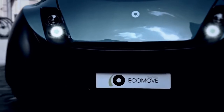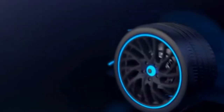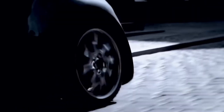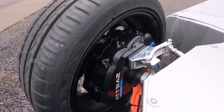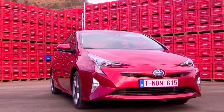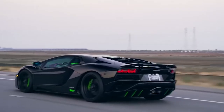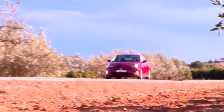The electric motor is the component which drives the car. The in-wheel active suspension system is an electrically operated system that can respond in as little as 3 one-thousandths of a second to automatically correct pitching and rolling actions. Some in-wheel motor layouts also deliver regenerative braking — the system captures some of its kinetic energy while braking and carries it back to charge the battery. Many hybrids, such as the Toyota Prius and Tesla Roadster, have already combined this regenerative braking technology, giving automobiles a longer driving range.